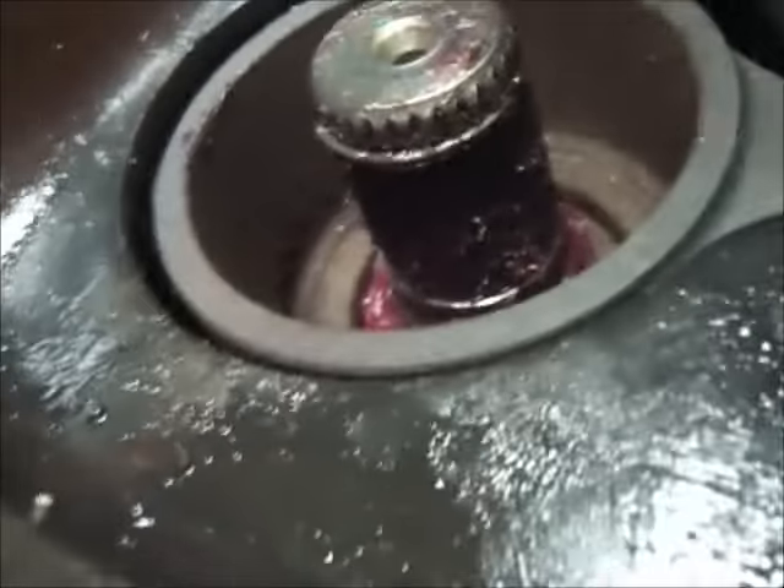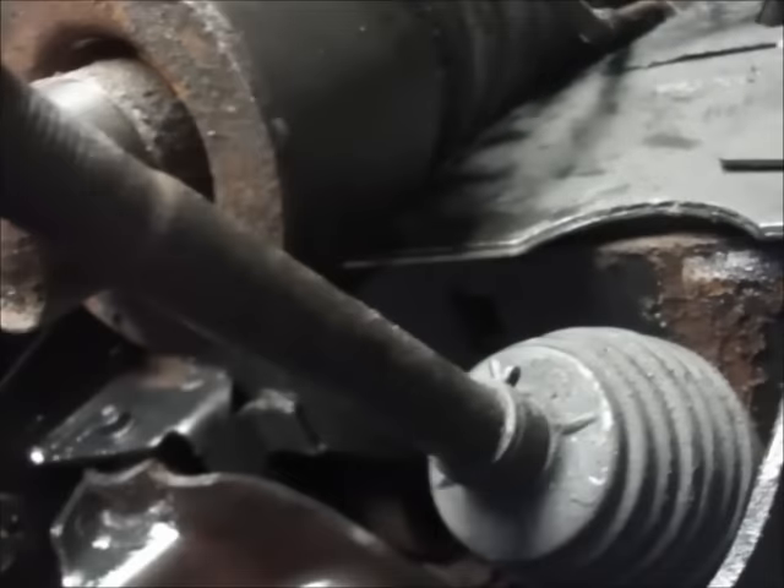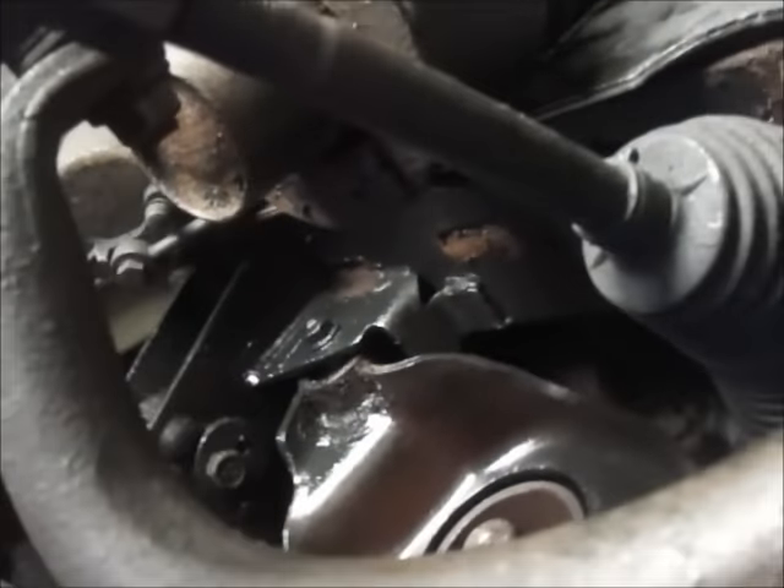The problem was right there, and that shaft went back in. The snap rings worked the way they're supposed to, went in pretty nice. I'm going to grease that up really good before I slide it into that. I don't even know if I'll get to that tonight, because I struggle with the extension on that strut — it brings that down and makes it really hard to get back together. I figure I'll be struggling with that for a while. But it's good that I didn't have to pull that out, send it out, have it rebuilt.